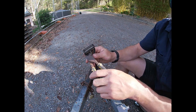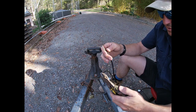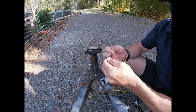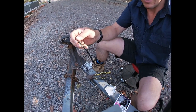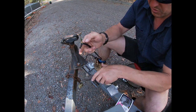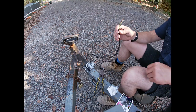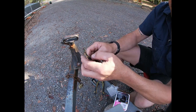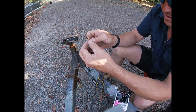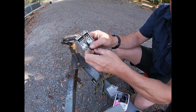I'm going to side-cut the wires right off and go for a fresh connection. This is pretty thin gauge wire. I'm going to expose just a little bit more of the outer sheath so I've got room to work and some fresh wire. Snip that off there — I've got the wires positioned like that. Checking where that's sitting in there — that's going to get clamped, and then the wires go in, so about there is where I want to cut those.